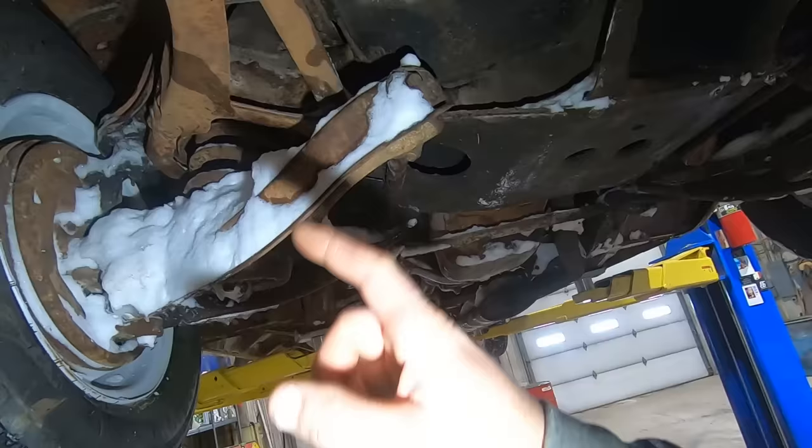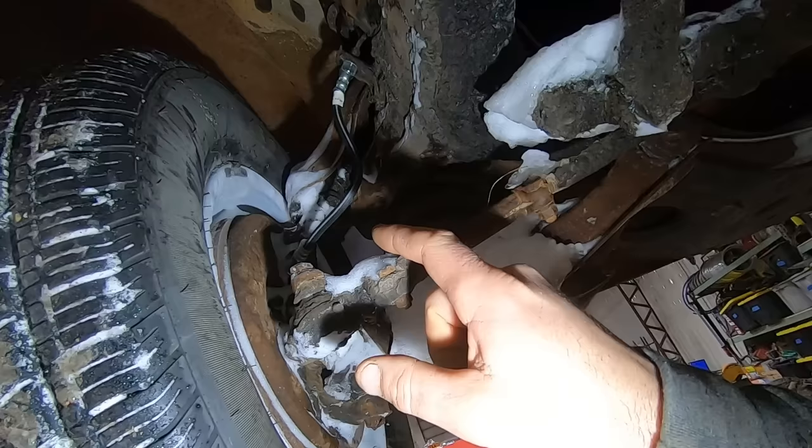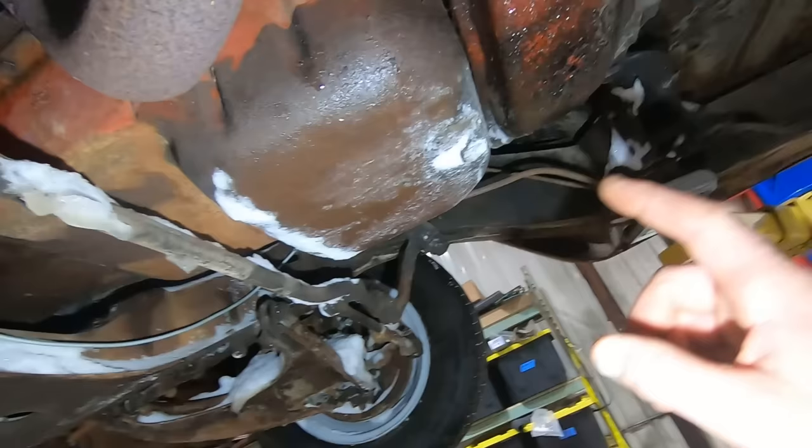Eli said he went through all the brakes. I don't know if that's just wheel cylinders and hoses, or I see there's a master cylinder on it. Oh, looks like he put hoses on it, so I'm guessing that's what he did, was wheel cylinders and hoses. Who knows if he put shoes and that good stuff in there. It's already been converted to an alternator. 235, 3-speed standard. Doesn't have all the overdrive goodness on there.